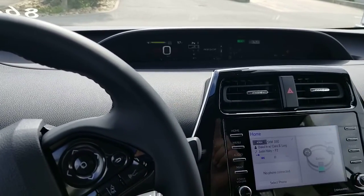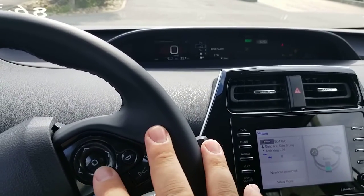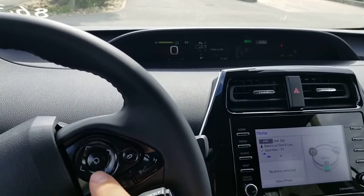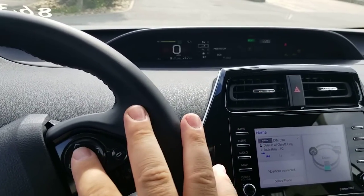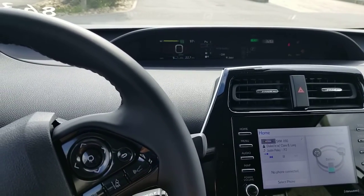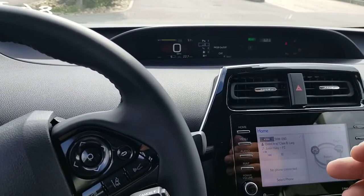So that's what that does. This one sees that you have something behind you and it can actually work — or not work. So if you're hauling a bike rack or doing something like that, and you want that to not kick in every time you go in reverse, you need to go over to this screen and hit that button. That's going to shut off your rear braking.